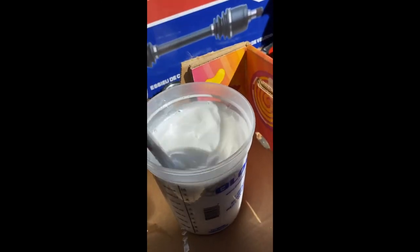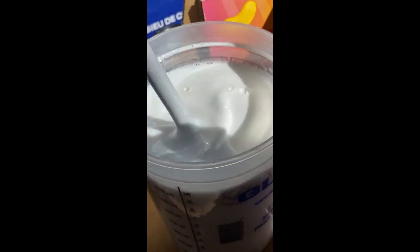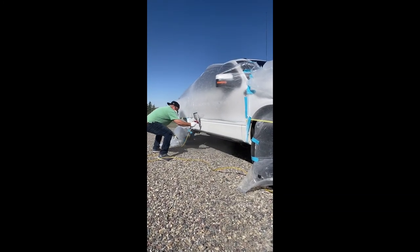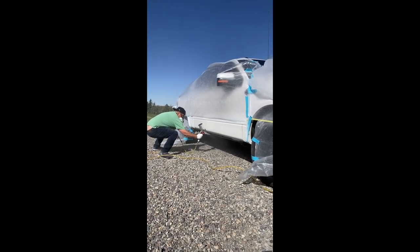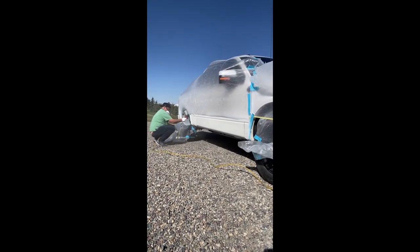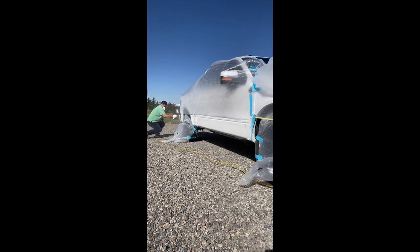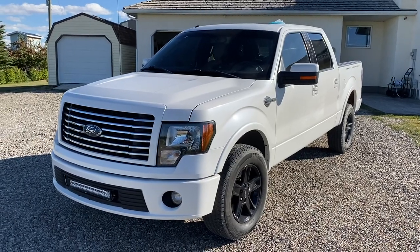Paint is really easy to mix up. Literally, if you go to a paint shop you can say print me off a form on how to mix up paint — it's easy step-by-step stuff. In this next clip you can see my dad; he's actually the brains behind this. I laid down my Raptor bed liner and he wanted to paint it, so you can see he's doing nice long brush strokes with that. No runs in the paint or any really bad imperfections — he's putting on the metallic right now. Just take your time and don't put it on too thick to get any runs.